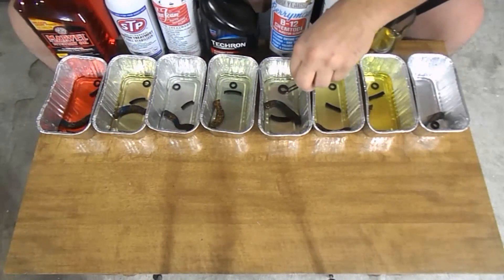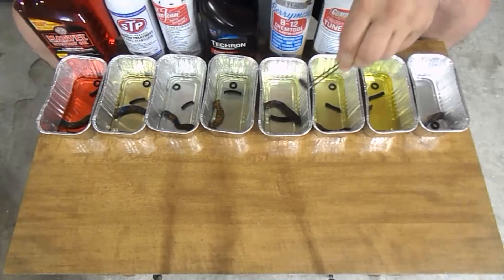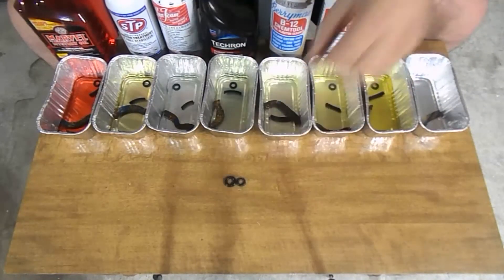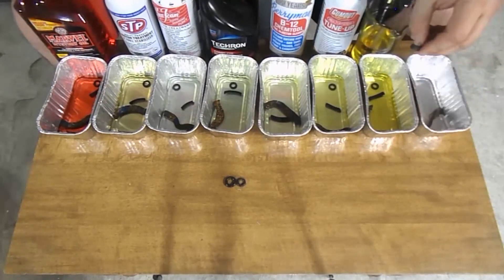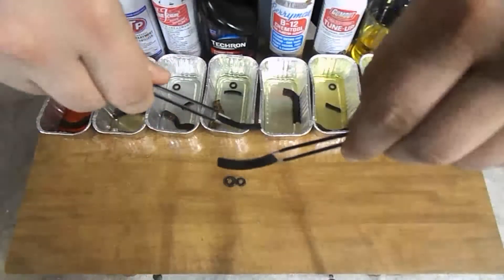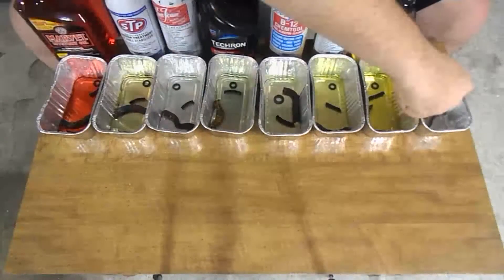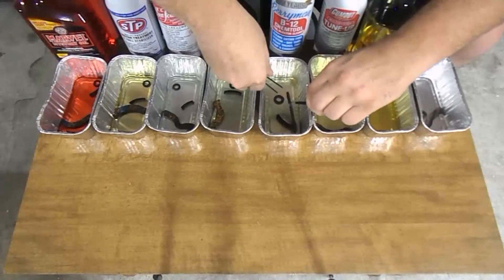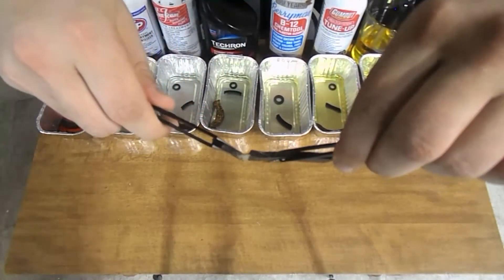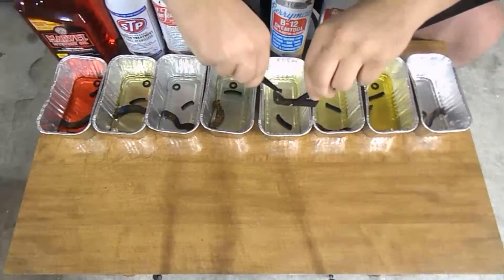Now onto the B12. The gaskets with the B12 have the most visual as well as physical differences out of all the additives. Here I'm going to compare it side by side with our control gasket. As you can see, the fuel injector O-ring with the B12 has almost doubled in size. I'm also going to compare it to the oil filter gasket — B12 is not recommended in the crankcase, so this part will be for demonstration purposes only. Now onto the cork gasket, which has had the biggest physical difference out of all of them — the gasket actually split in two. Remember, B12 is recommended to be put into the gas tank, and in some vehicles you can find cork gaskets on the fuel pump.